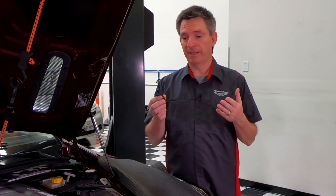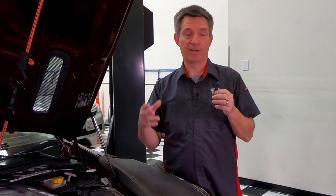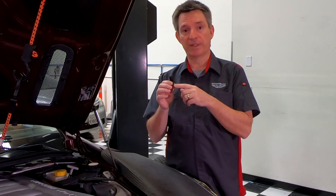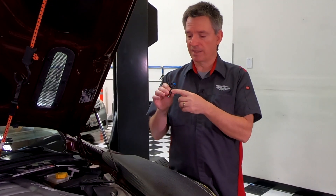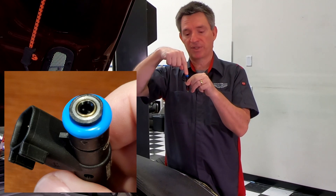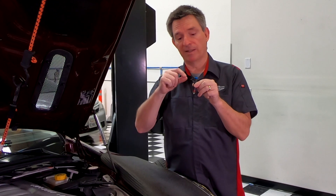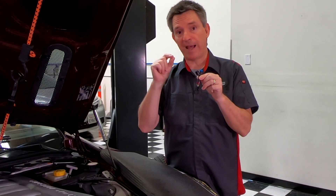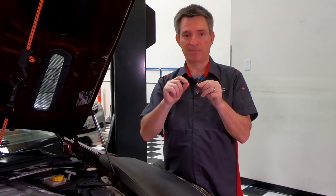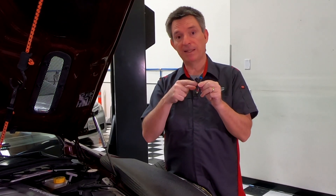So what role does the fuel injector actually play? It's critical in our modern engines. There's a computer that controls the engine and it listens to the signal from the mass airflow sensor — it knows how much air is coming up the intake system and can precisely inject the amount of fuel necessary to match that airflow. On one side of the injector is the fuel rail, with about 40 PSI of fuel pressure sitting there. There are electrical connections to a solenoid valve inside the injector body, and the computer can open that valve for very fast periods of time, varying how long it stays open. Keep it open longer, more fuel goes in — the engine can precisely control the amount of fuel for each combustion stroke.